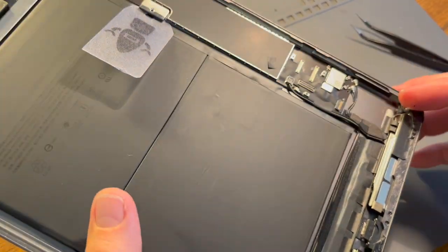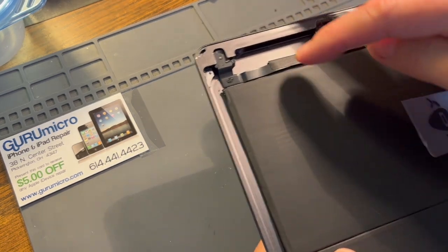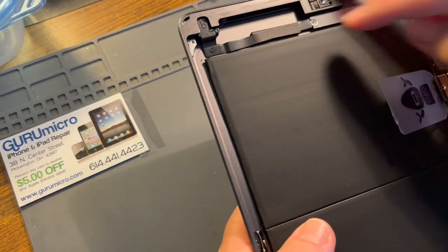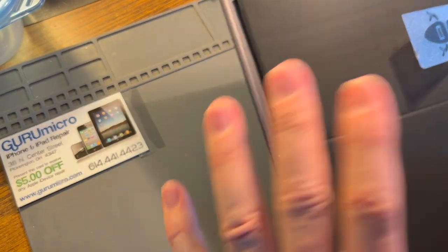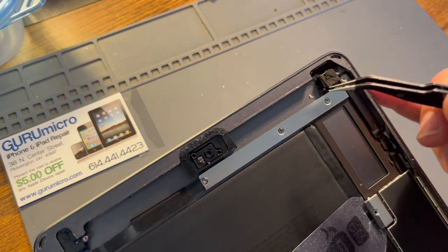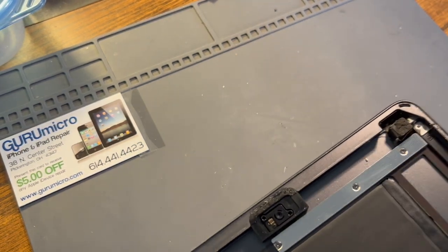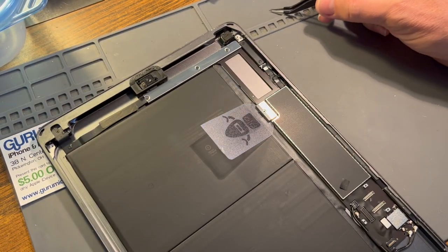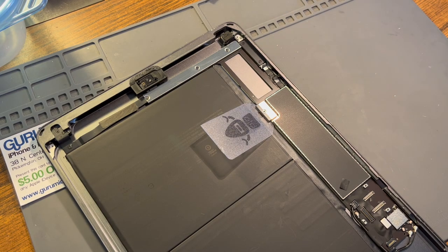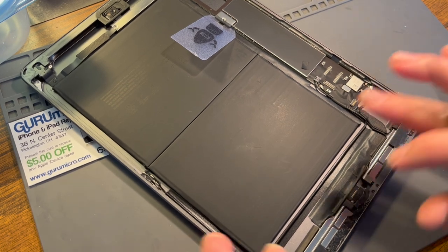This area right here I mentioned earlier — this is a Wi-Fi antenna at the bottom of the iPad. The home button would be here. On both sides we have these Wi-Fi antennas. As you are working your tool around here, you want to be really careful not to cut into these antennas, but you do want to get all that adhesive up. Take a lot of care here to make sure you're working the blade in a direction that is not going towards this, because you don't want to cut this antenna or you'll sacrifice Wi-Fi signal strength. There are two of them, so this whole bottom area — take your time.